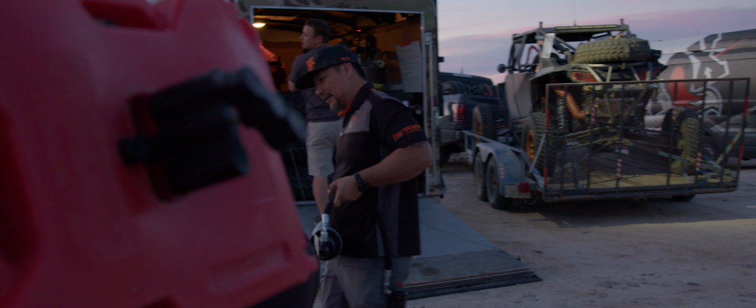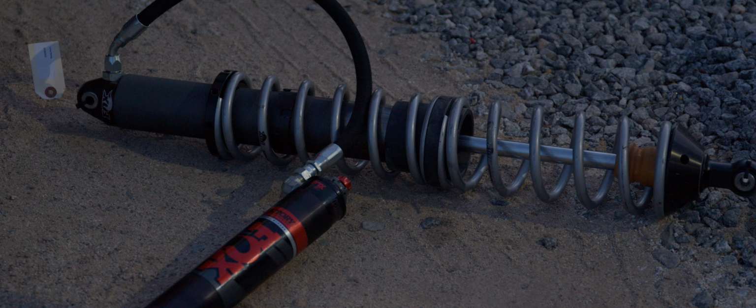So what difference was done to these things? Changed valving, and then we changed the inner bodies. The other inner bodies had smaller bleed holes and stuff like that, and different positions. Yeah, and so this is a better body. Gonna go through the big stuff easy. Basically, gonna make our pre-run a little more enjoyable.